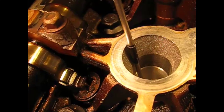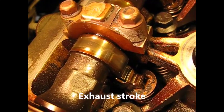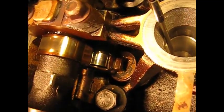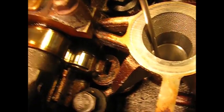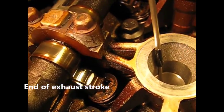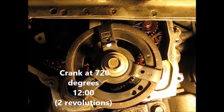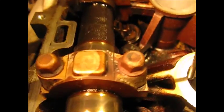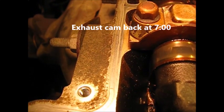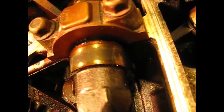The piston is down and we're moving into the exhaust stroke. The piston is coming up and you can see the exhaust valve opening. End of exhaust stroke — back where we started, 720 degrees later, two full revolutions. The crankshaft is at 12 o'clock. The exhaust cam is back at about seven o'clock, where we started, and the intake cam is back at about five o'clock.